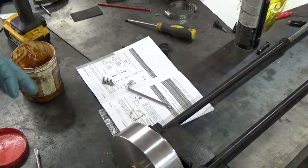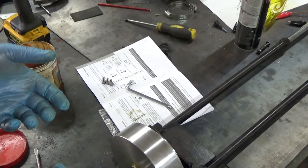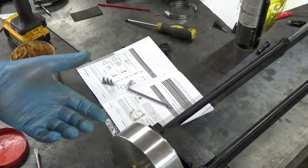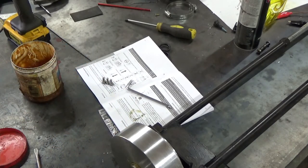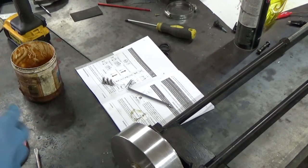That is too tight as shown. As the bearing heats up it will expand, creating more friction, which builds up more heat, which expands it even more. The bearing may get to 100 or 200 degrees centigrade under normal use. At that temperature, the steel will expand by one or two thousandths of an inch, and you can't measure that because there's grease inside, so you have to guesstimate it — and this is the rule of thumb.